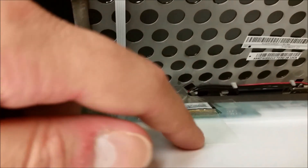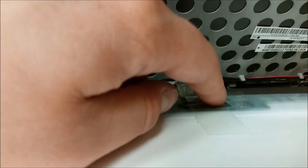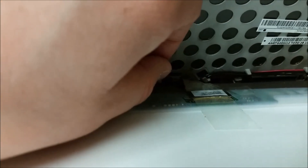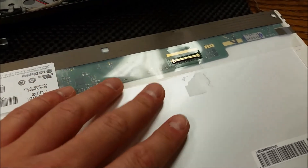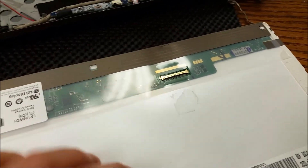You may want to be careful here — I've got the hinges. Notice that they've been disassembled and the display is flapping free. Now you do have to disconnect the display, so we're going to go under here. There's the only cable you've got to worry about. What we're going to do is take this tape, peel it off the connector, and it just pops right off. I've taken the tape off, which the old screen doesn't like when you do that — there's a little bubble here. But we don't care because we're going to throw it away.